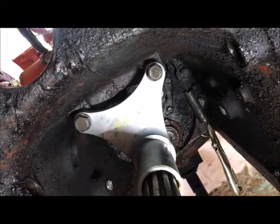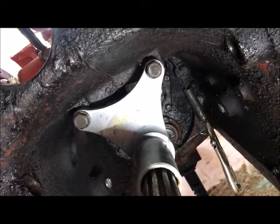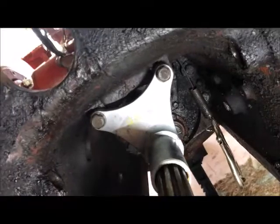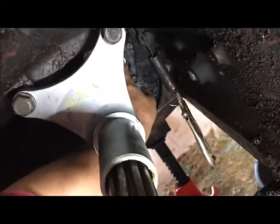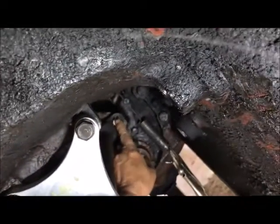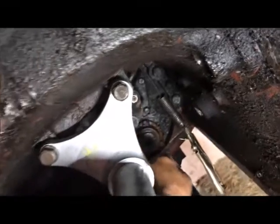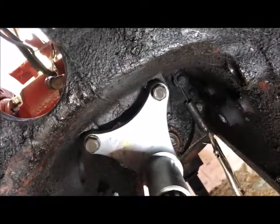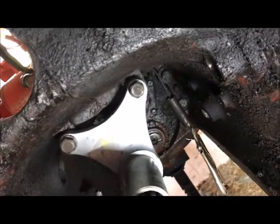It didn't take but a few tries for me to figure out that the washer needed to be bigger. The bolts that hold the yoke pieces on back here are tapered, and I was trying to tighten it down but that washer was catching because it tapered up from one end to the other. So I had to get a bigger washer.